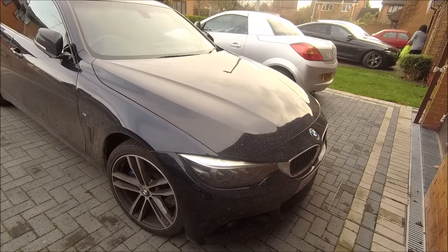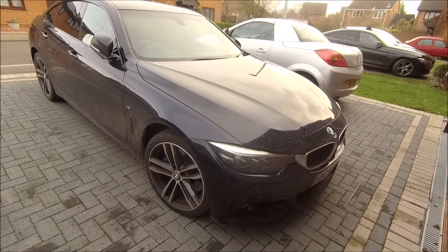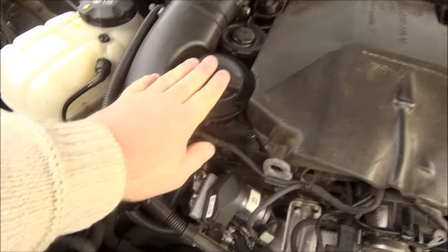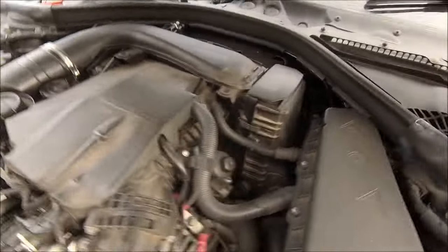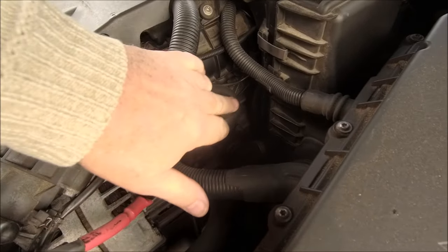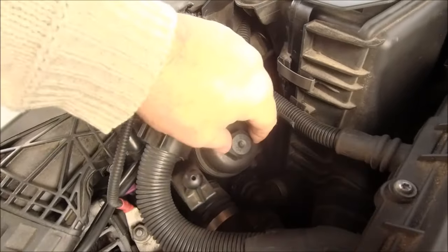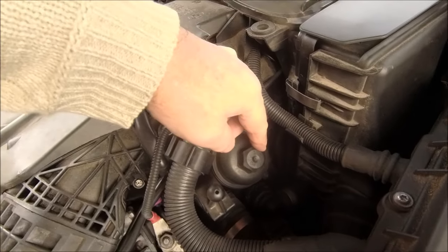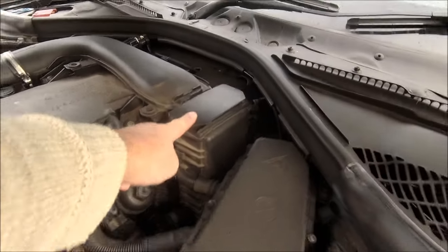It's going to be a short video because oil changes are really boring and not much to tell you about them really. So to give you an idea what's going on - the oil filler is obviously there, took the plastic off the top. The oil filter is there, 25 newton meters apparently when you torque it up. I think that is a 22 but I could be wrong.